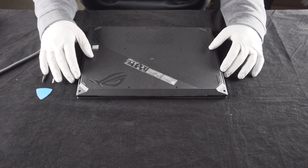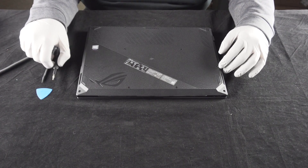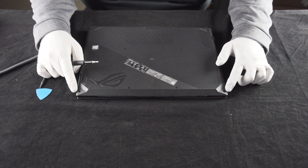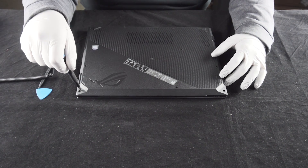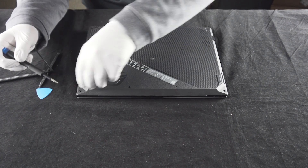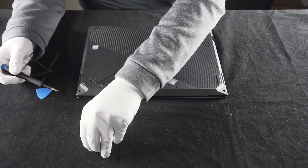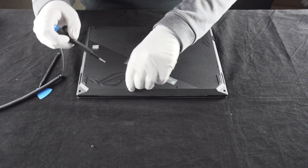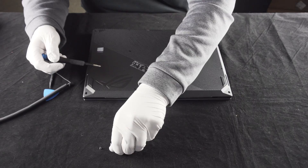This is a one panel removal. Based on the panel design as well as the thickness of the laptop, it's probably not going to be a board flip. You can tell from the corners that it slopes down, so most likely these are going to be shorter screws. We'll need to keep track of which screws go where. We typically recommend laying the screws out in a grid matching their positions as you remove them. So we're just going to continue making our way around, getting all these screws out.